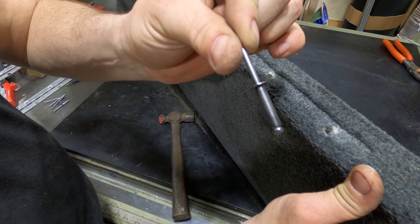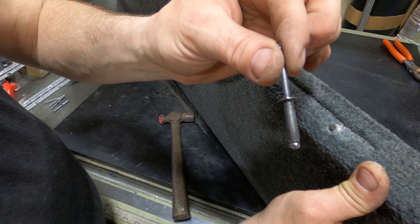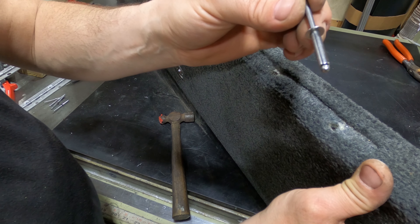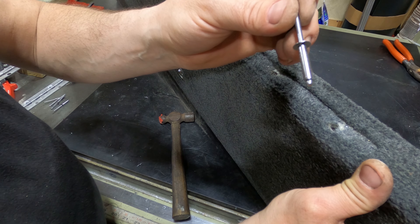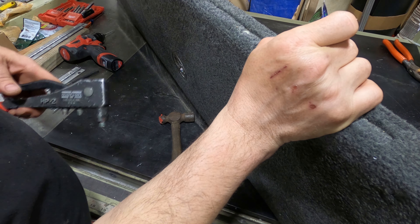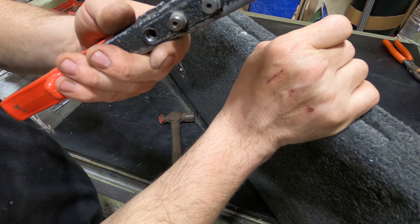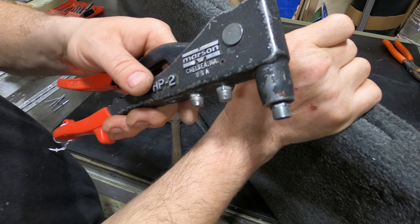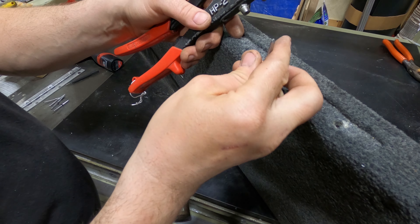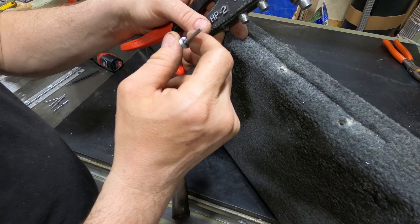Now I'm going to be using stainless steel rivets this time — I don't want this to break ever again. I'm going to be using 3/16 18-8 stainless steel rivets. I got them from McMaster-Carr; I'm going to put links in the description below if you want to pick these up. These are 3/16 18-8 stainless steel, about three-quarter of an inch long. To install these you'll need a quality rivet gun — this is a made-in-USA gun. I've been using it for a couple years. You need to spend money on a good quality rivet gun, otherwise you won't be able to pull these stainless steel rivets since they are a lot stronger than your average aluminum rivet.